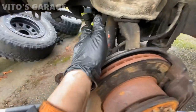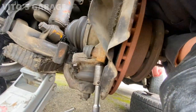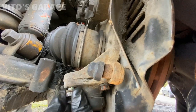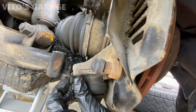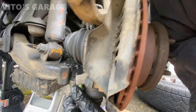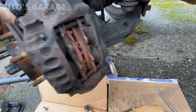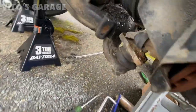Decision is made - we're gonna loosen this ball joint. It's actually really nice on this - I think a lot of Toyotas do that so you can just remove these 13 millimeter bolts and it literally separates. You don't have to hammer anything at all, pretty cool. Now those bolts are hard to get to so you just turn the knuckle this way and you can get to those bolts easy. The axle is out on that side.